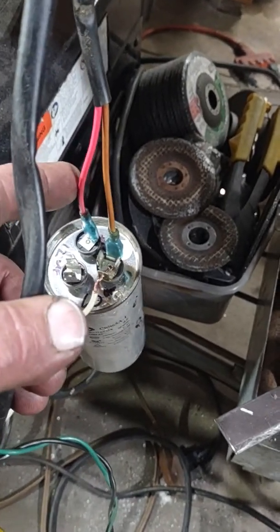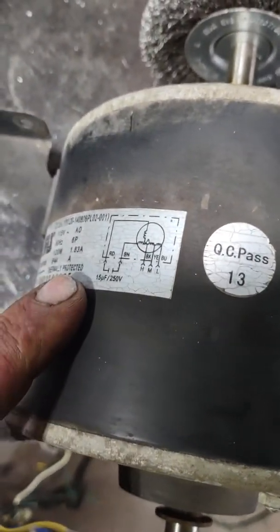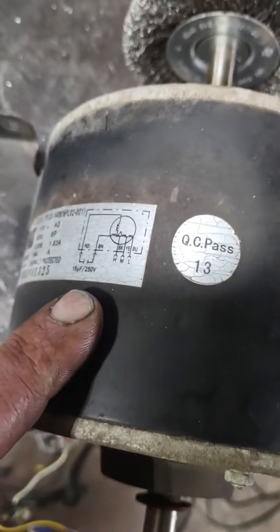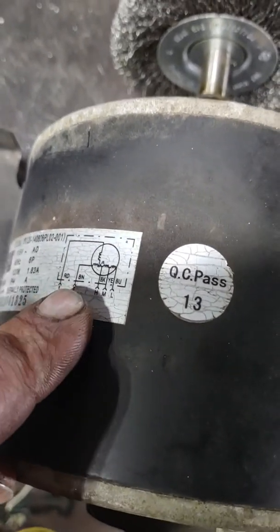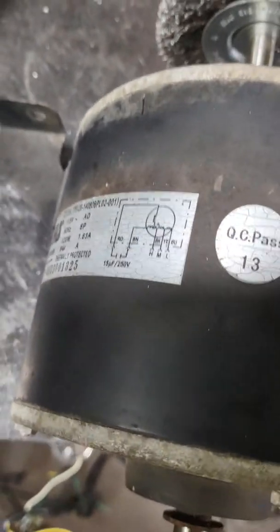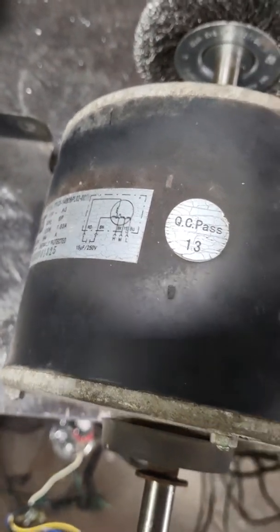Your red is hooked to the other side of the capacitor. For this motor, you need at least a 15-microfarad capacitor rated at 250 volts. The diagram shows red and brown going to the capacitor, but doesn't show the neutral coming in. What I did is hook the neutral to the brown terminal on the capacitor, and it works like a dream now.